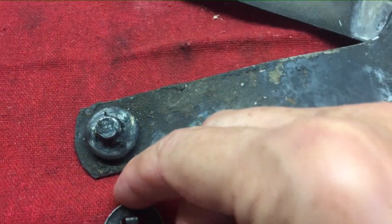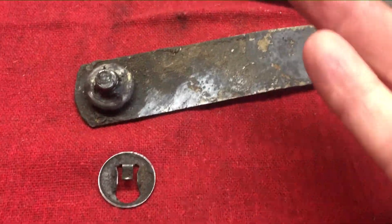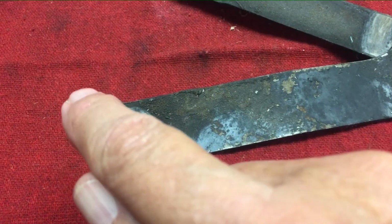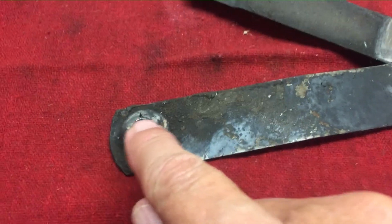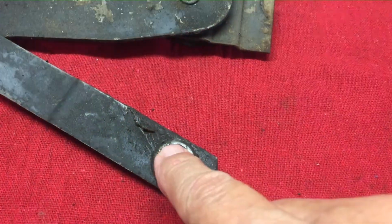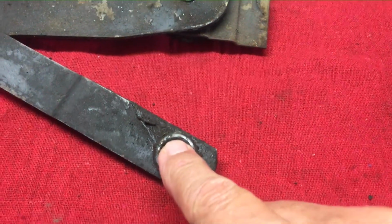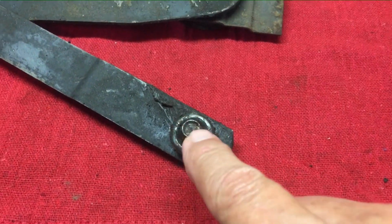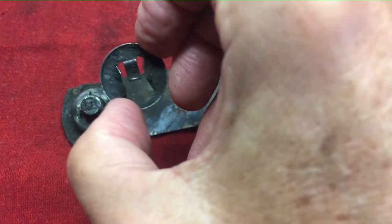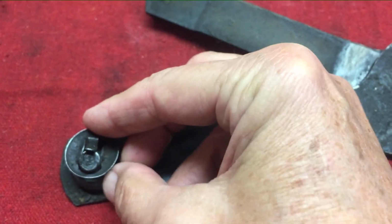Now, that's very simple. There's not much thought process to it. And as I said, the most difficult thing is this pin, which is closest to the rear of the door, is the easiest, while the pin that is directly under the window lever is actually the hardest. I actually had to use a mirror and a flashlight that I could place inside of the door frame so I could see what I was doing there, so I could get this clip lined up correctly so I would know which way I would have to push it to get it off of the pin.